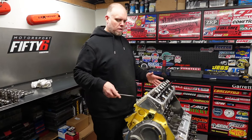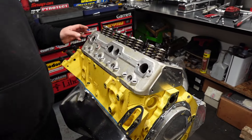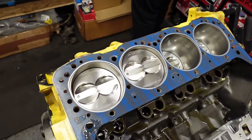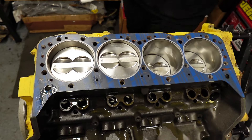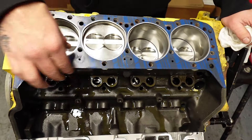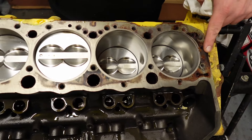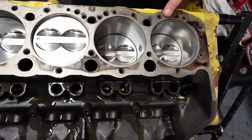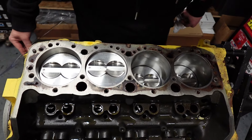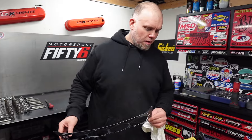Alright, so we've got the valve train off and took all the head bolts out. So far we haven't been able to find any problems. Everything looks fine — looking good. Hopefully when we take the bottom end apart and take the crank out, it'll be okay too. The block probably needs to be surfaced because there's some rust there — it's been sitting a long time. Once we get the pistons out we'll check the bores, check the crank, check the rods, the bearings, and everything.